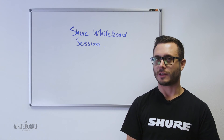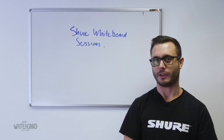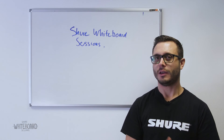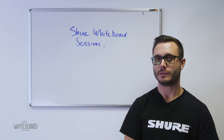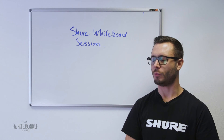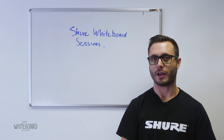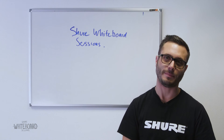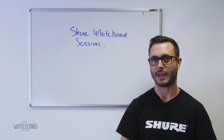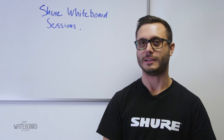It's estimated that when a battery has completed 500 cycles it will still be at about 80% health. So if a battery could last 10 hours when it was brand new, after 500 cycles — which equals one full charge per day for about a year and a half — you'll still have about 80% charge capacity after a full 18 months later. Think about how many double A's that would have been.